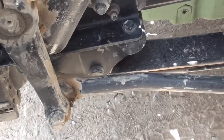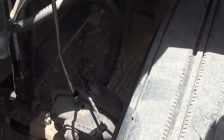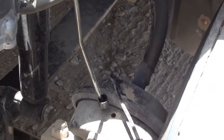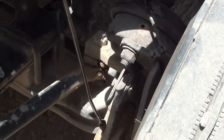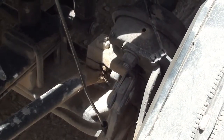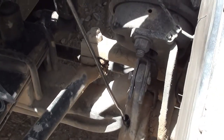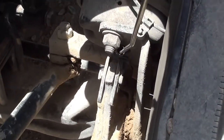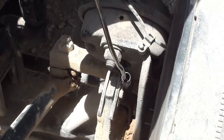From here, we're gonna go to the brake chamber. The brake chamber and the brake chamber hose. Properly mounted secure, not broke or damaged. No missing hardware, no leaks. And then we go to the push rod, the cotter pin, and slack adjuster. Properly mounted secure, not broke or damaged, no missing hardware. We need to say the adjustment of the brakes. So we're gonna say push rod should have no more than 1 inch play with the brakes released. From here, we're gonna go to the inside rim.